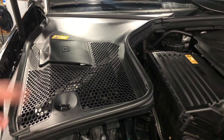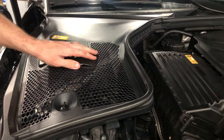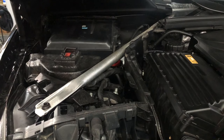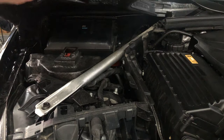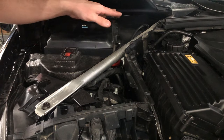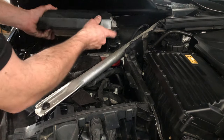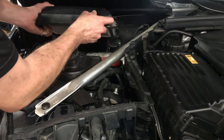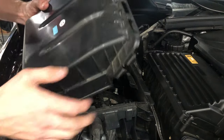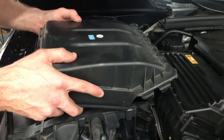Next up, we're going to do the dust filter. This one is inside the hood, behind your battery. Go ahead and unlock the plastic panel — it's literally just two latches. We can do this without even taking it out from underneath the engine compartment, back up under the windshield. Just hold it up with your shoulder and pop it out of its spot. It literally just lifts up and pops out. In the back, it hangs on tabs — hooks over and then snaps into place.